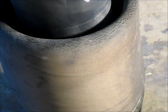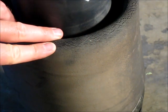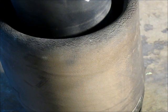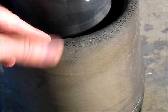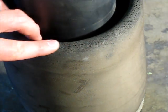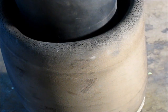Now that I've begun to free the lower plastic bell housing away from the strut, this is a good time to show how deteriorated this rubber can become as it folds under. This air spring is being replaced at approximately 95,000 miles — that's probably the upper limit for the original air springs, depending on climate. As the vehicle rides, the part of the rubber that curves under this bell housing receives the most wear from constant movement up and down, resulting in fatigue, cracking, and dry rotting. The leak is probably coming from the O-ring seals or the junction of the bag to the strut.